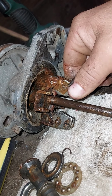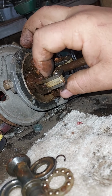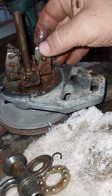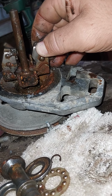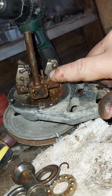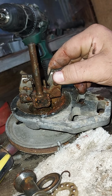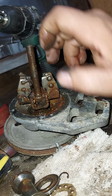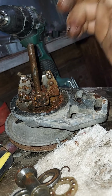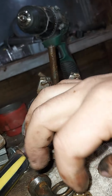I'm not sure how much movement's considered acceptable because I know governors can break free. It's not really as bad feeling as this. I think this one, when it goes and wants to pull, which tells me either the pin's got a groove or the weight's got a worn spot, because when it lifts up, it wants to rock back this direction. So, all right, well. Gotta get some parts.